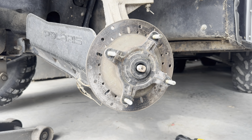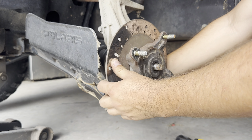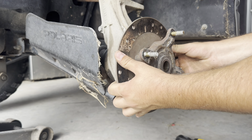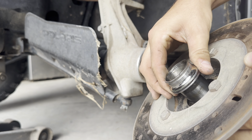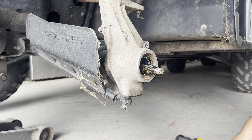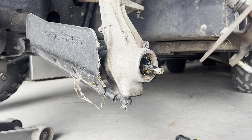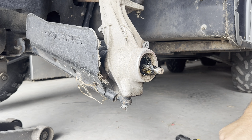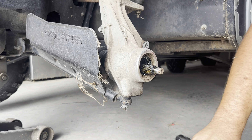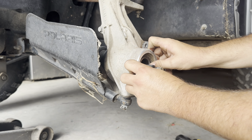If there's a lot of pressure on this brake line, I usually will just zip tie it to the shock, but we seem like we're all right right now. We'll straighten this back out and pull this out of there. Sometimes it has a two-part bearing and the bearing inner will come out — just slide it off. It's just a little inner bearing; slide it right back in there so those bearings don't slide out.